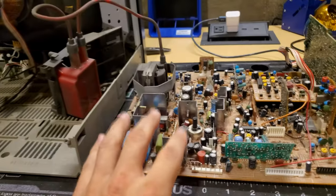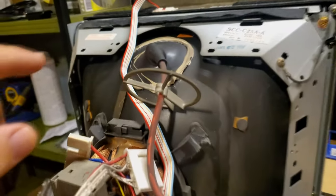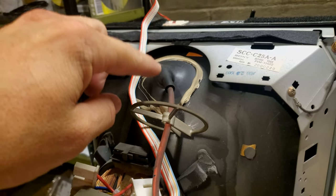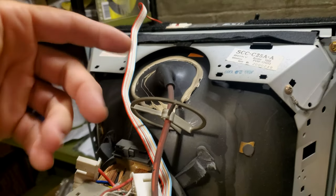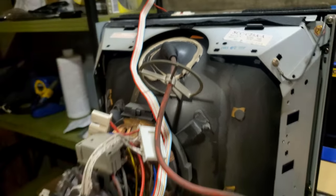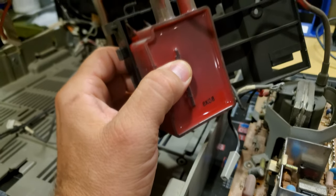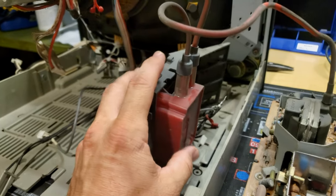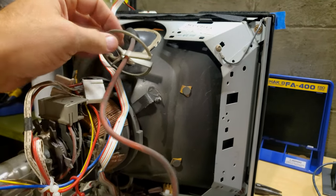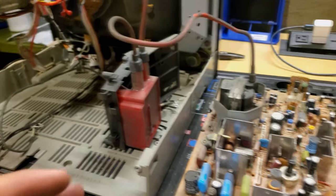We're going to get in here and service this one. This is a unique design, one of the older designs from Sony. One of the things they used to do back then was silicone the anode cap to the tube itself up here, which presents a challenge to get that off. Most of the time I decide to just leave it in place. This is the high voltage resistor assembly — a proprietary part from Sony. Sometimes it can go bad, and that's really a pain because it's all one solid encased unit and very difficult to find old stock of.